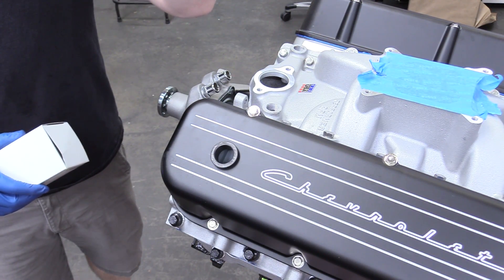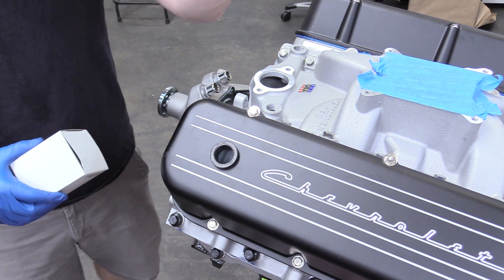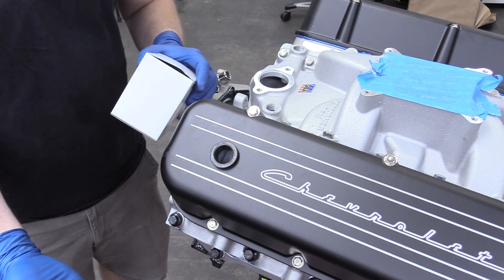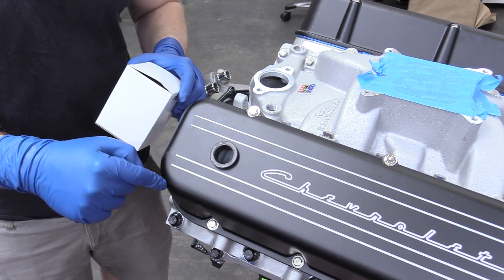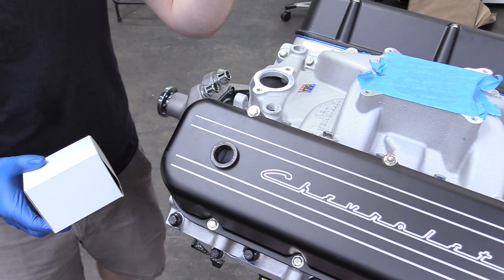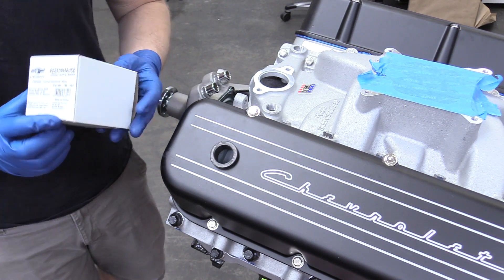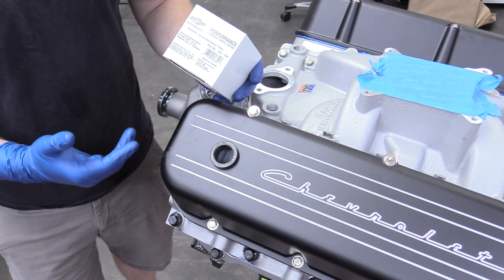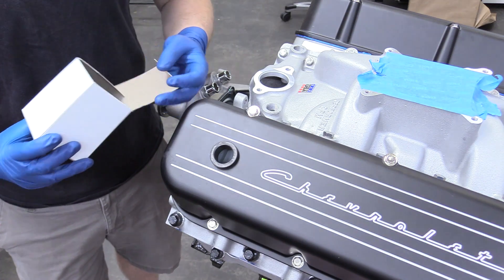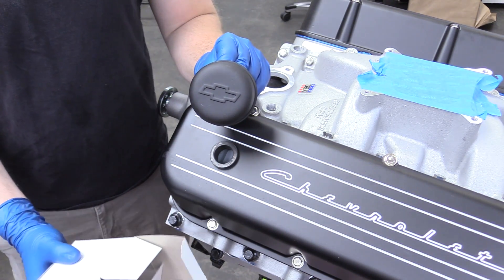We're basically right over the number one cylinder, and this is going to be the one closest to you because this is not only our engine vent — where excess pressure is let out or if air is needed to be put into the engine to prevent damage, regulated with this breather — but this is also where you're going to be adding engine oil, so you want it as close as possible to you when it's in the car or truck. This is made by Chevrolet Performance, part number 141-754. Link down below in the description. I bought it because it's black and it matches my black top cover.